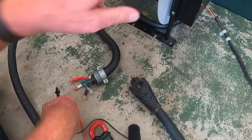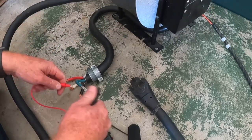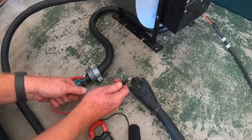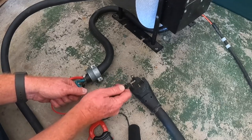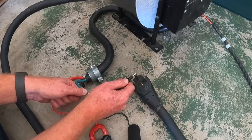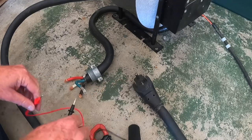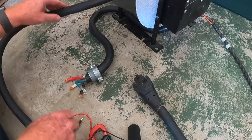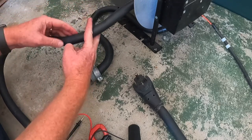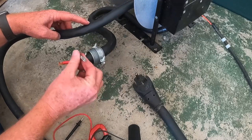And if I had to guess, it's on this rotary part. And then the other one is the ground, which should be this one, but I think it wasn't working either. Yeah, let's try this one. So both my ground and my neutral have no connectivity. So I think, and I hope, that again the problem is inside this rotary piece. So if I cut this right here, I'm gonna have good connectivity. And again, then I'll be able to make up these wires.